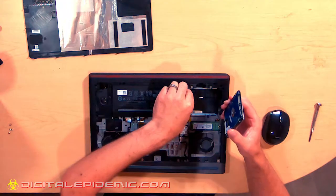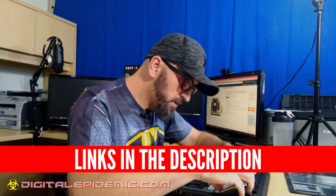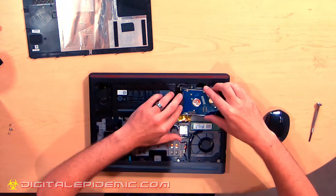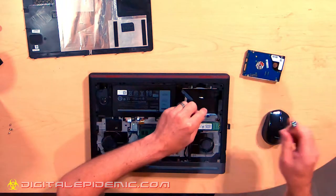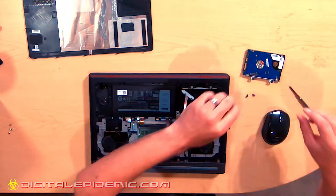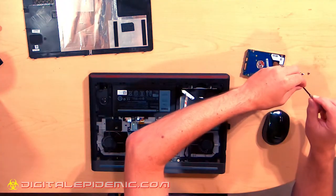This one just happens to be a Seagate 320 gig that I had laying around, but I'm going to make some recommendations in the description for what I think you should get. This is an old-school platter-style hard drive, meaning it has mechanical moving parts. Let's see how it's going to fit — we'll want to lay it like that. I'll pull it back out; it looks like they have hardware in here, so we're going to pull these screws, which gives us this little drive rail on the side. We'll line it up with our hard drive. I just happen to have screws from the laptop I took this out of — if you don't, I'll link those in the description; you can pick some up cheap on Amazon.